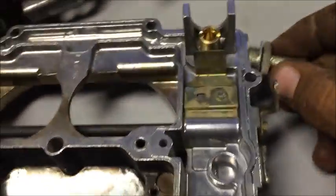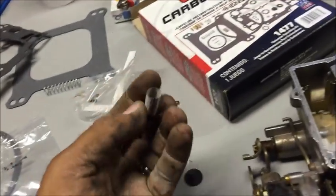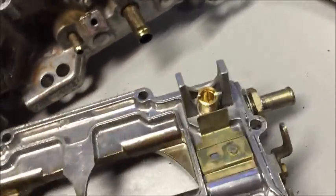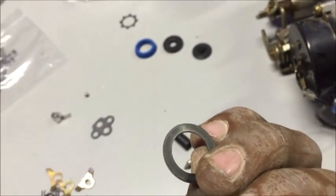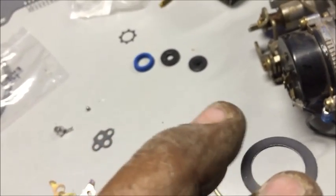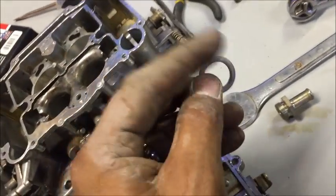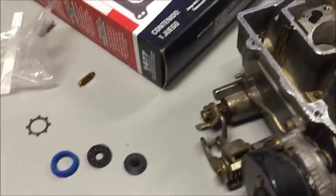Just in case you're doing a 750 — I told you when we took this off there was a screen behind it, but there wasn't. So in your kit, that's what that screen is for. This is a universal kit, so that's the reason we're not going to use it, but that's where it would go. Before you stick it on, change the gasket with the new kit. Look at the washer really closely — it looks the same on both sides, but if you really inspect it, you'll see the Teflon coating on one side. That Teflon is going to go up against the carburetor, and the metal side goes towards the bolt.